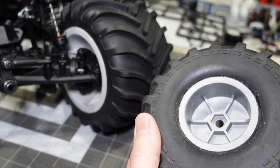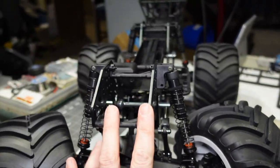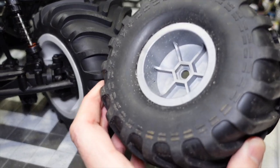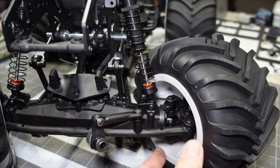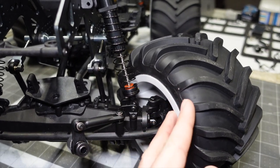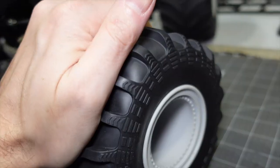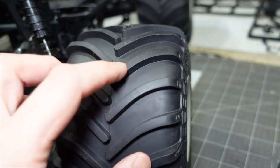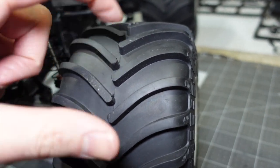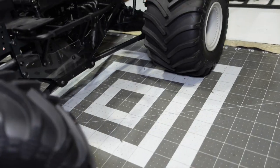This is a specifically designed wheel for this chassis — you cannot run older style monster truck wheels on this because it uses a 17mm hex on the LMT versus a 12mm hex on older monster trucks. They've also made the wheels significantly bigger, similar to a short course wheel where you have a shorter sidewall on the inside than the outside. The tires are vented through the wheel but not through the tire body — I always poke holes in the tires for wet running to let moisture fling out.